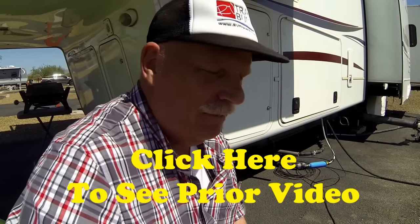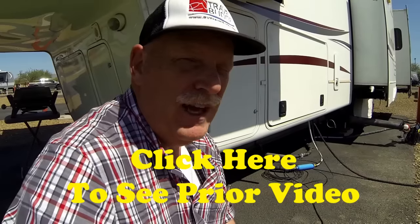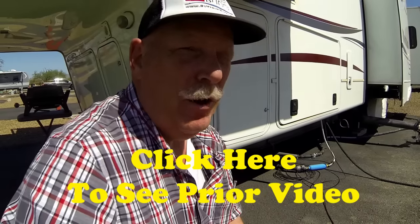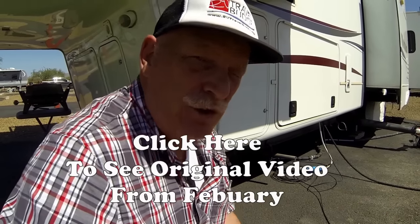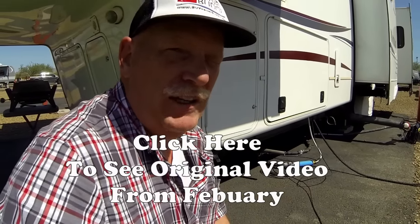So that's how we did it. I want to thank everybody for the great questions and comments from that video, and I hope that gives you a battle plan if you blow a tire on your RV. Try to get to soft ground if you can, in case you have to dig below the tire. If not, that's how you get your RV off the ground to change a flat tire.